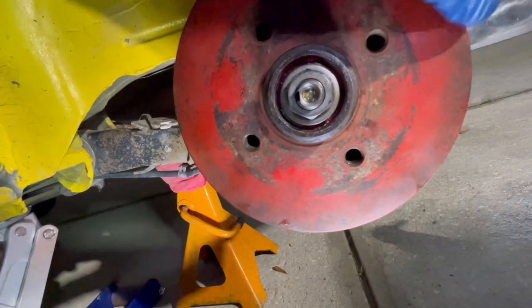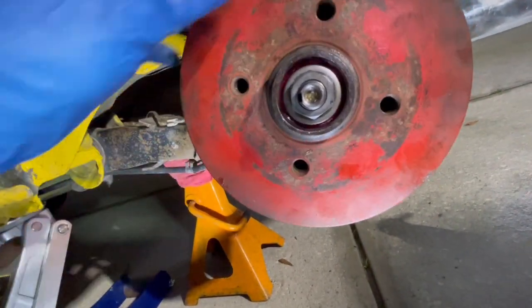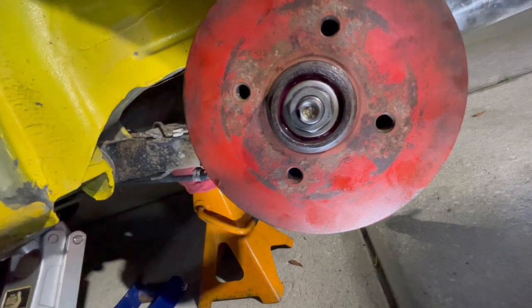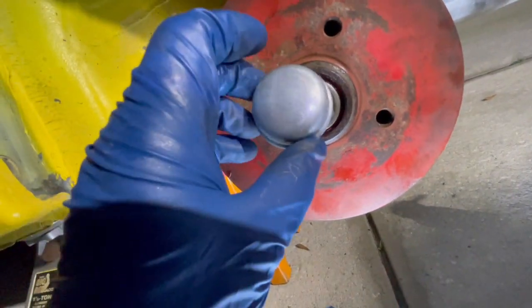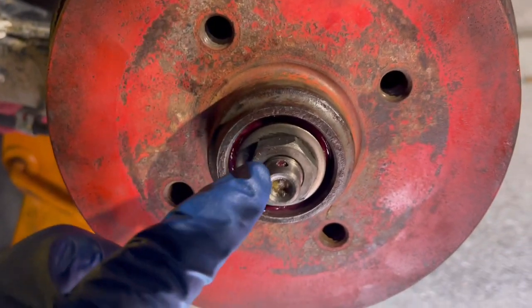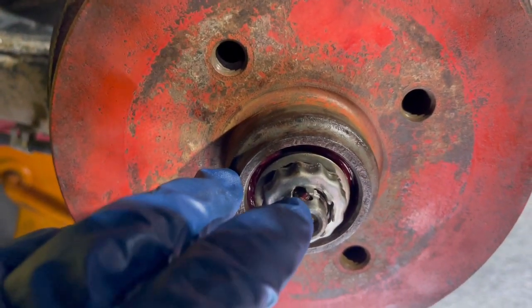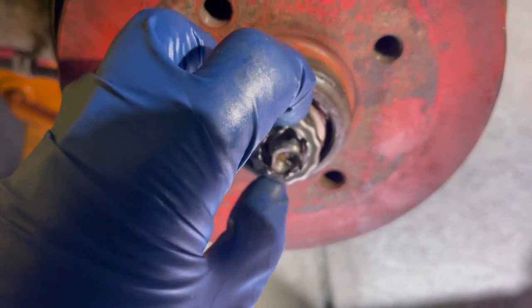It's going to feel like there's some resistance because you've got all the brand new grease in there. Just pull on it and make sure you don't see stuff moving around. Tighten it up — I'll just give it a little bit of a tweak with the wrench, and then put the little crown cap, cotter pin, and then the grease cap. I'll also be putting some grease in here so it can feed the outside of that wheel bearing. When snugging this nut, make sure when you put the locking crown on that the hole for the cotter pin lines up as best you can — you'll need to turn that nut to where it lines up, otherwise you won't be able to put the pin in.